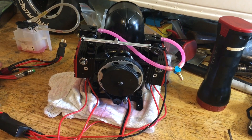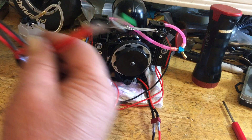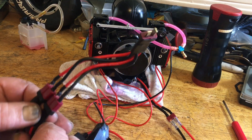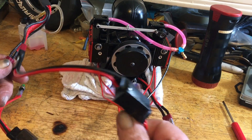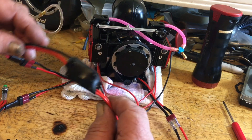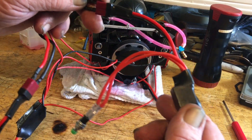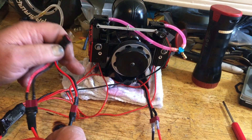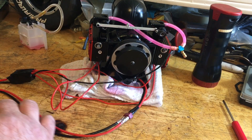The starting setup is pretty awesome. It's all plugged in together with a push button switch. I'm using a three-cell 11.1 volt to run the igniters. They've got micro igniters - four into one - you can unplug them too. This here is your starter relay with your push button. When you plug in the juice you get a direct voltage to your glow plugs, and the push button starts your engine. Pretty unique, nice setup.